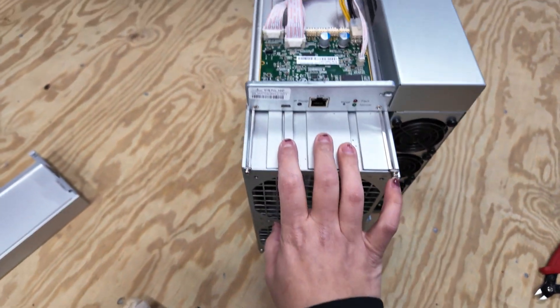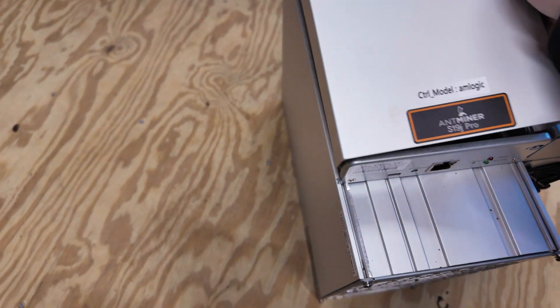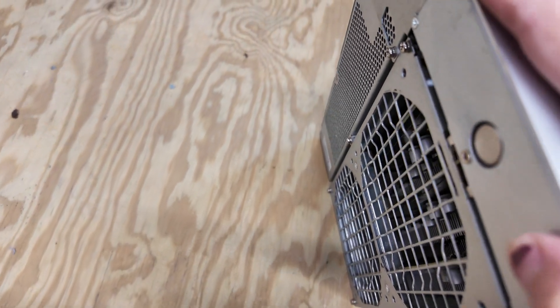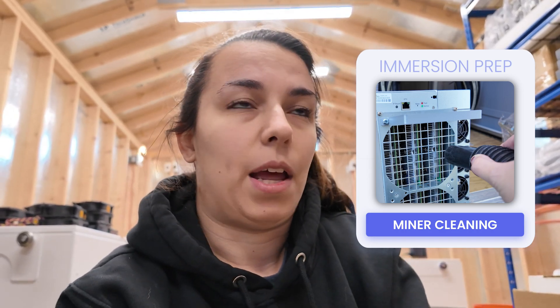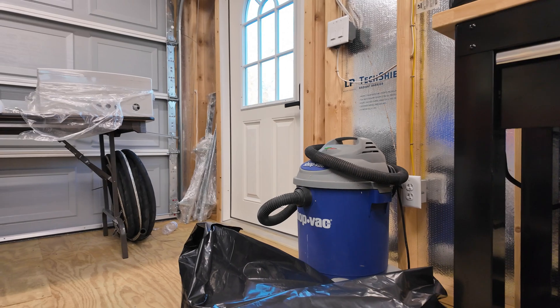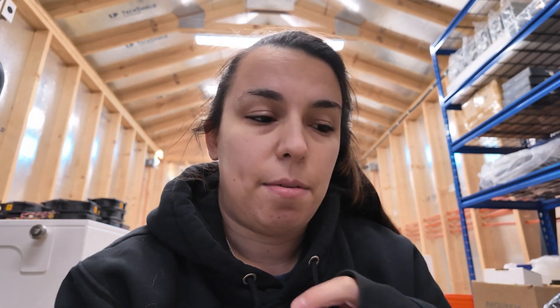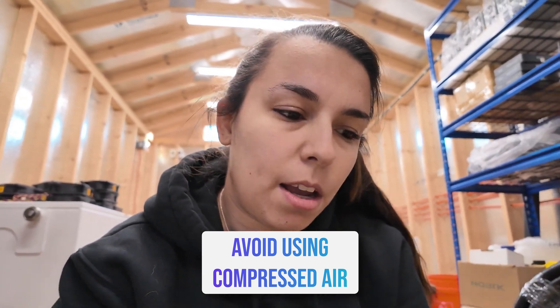So those are now off — we've got our front fans off and our back fans off. Then we're just going to slide this plate back on. After we remove the fans on the miners, before we dunk them, we also want to clean them a little bit. A lot of these miners were out in the digital shovel, so they've had some exposure to outdoor air. We have filters but some stuff still gets in, so some of these miners have a little dust, dirt, or even some bugs in there. So we'll just take this shop vac and use that to blow out some air through the machine and try to get some of the dirt and dust out. I've heard it's not recommended to use compressed air on these because it can have some moisture within it, so we'll be using a shop vac for that part.